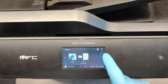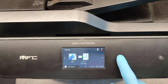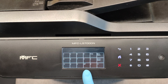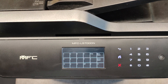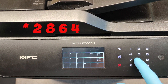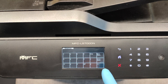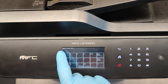Click on the settings button, then press the home button until we get this screen. Press here, then on the right side on the keyboard press two eight six four, and we will enter the maintenance mode. Then press eight eight and we are in the menu for resetting modules.